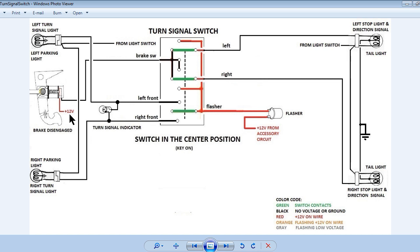This connection is generally connected to a constant voltage, providing 12 volts whether the key switch is on or off. Notice also the 12 volts accessory circuit connected to the flasher. On most Ford cars the key must be in the accessory or the run position in order for the turn signals to work. This is to prevent the turn signals from operating while the vehicle is parked — imagine coming to your vehicle the next day to find a dead battery because you forgot to center the turn signal switch. Also notice that the output of the flasher is shown solid red, which indicates there would be 12 volts on this wire.